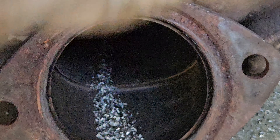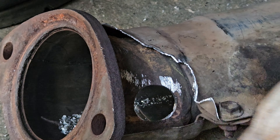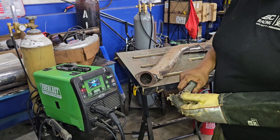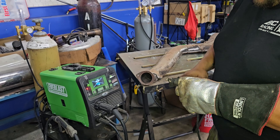He did a great job. You go all the way in to the biggest hole at the 7/8" countersink and it works perfect. I'm checking to make sure that the bung fits — the countersink part of the bung fits right into the hole and the outer lip stays on the outside — and it'll be perfect for getting it welded.